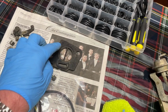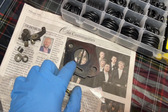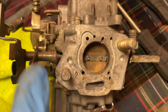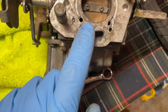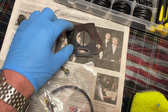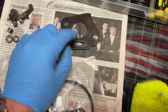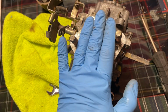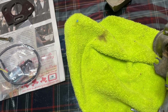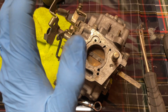This is facing on the outside, which gets a rubber seal. And you'll see there is also a little rubber seal right there, and I cover all this in videos, but it covers up this coolant port right here. So basically it goes plastic insulator, paper gasket, and in that paper gasket there is a pocket to put that rubber seal, which then all sandwiches up against the carburetor. Again, you will see all this stuff when you take your carburetor off.